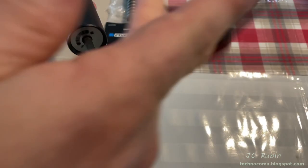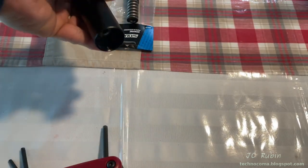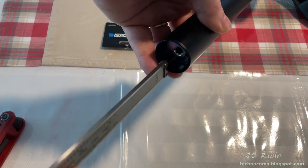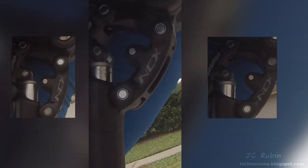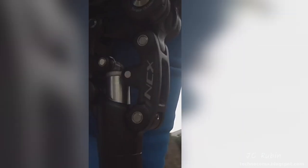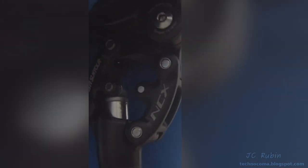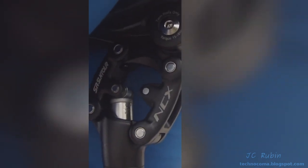I put the adjuster back in and dial it to just over a centimeter — the absolute minimum they allow. Starting there, it's essentially zero preload and almost full compression, so definitely not enough. Adding one more turn, things are looking close, but on a big bump it almost bottoms out. It does look good over grass and dirt patches, absorbing a lot of shock, but still a bit loose. I'll tighten it up maybe half a turn.